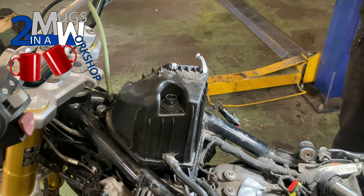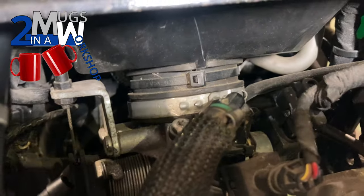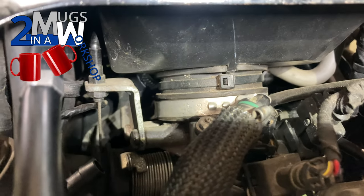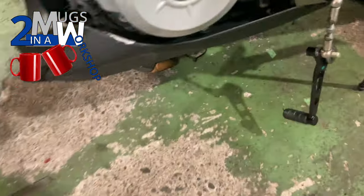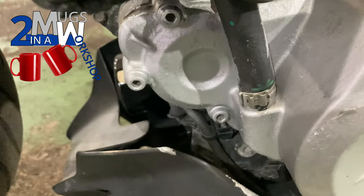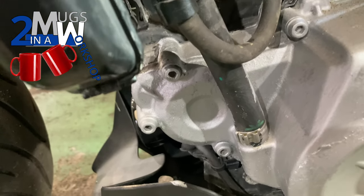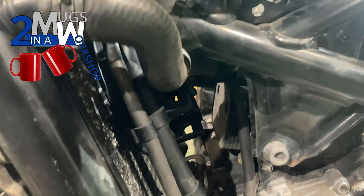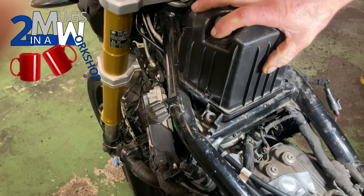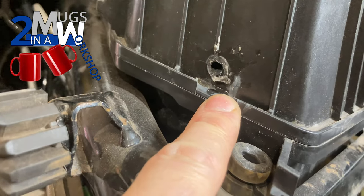Just going to remove the bolts — they're just 5mm hexes on top. Everything else seems loose so hopefully it'll just drop off. Look carefully — there's a cable tie so someone's cable-tied that on there. You've also got a breather hose coming off the bottom of the air box going down to the crankcase. You'd have thought it would be easy to release it at this end and lift it out, but it has got one of the famous ear clamps on it. There is a jubilee clip on there though, so it might be easier to get access to that and release it at the jubilee clip. Just grabbed that pipe and it just fell off in my hands — the one that had been bonded on. Really glad I did this.